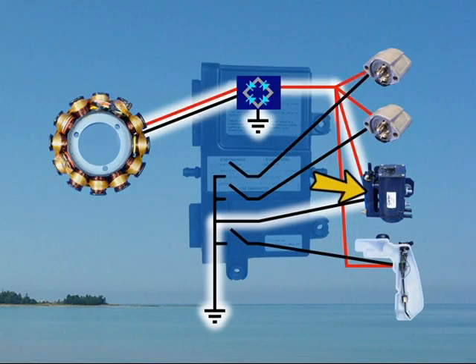The fuel circulation pump is actually designed for a 12 volt system. The EMM on inline models uses pulse width modulation to provide the correct average voltage for the pump.